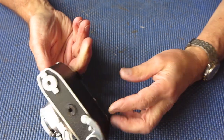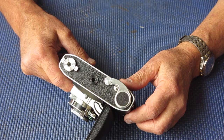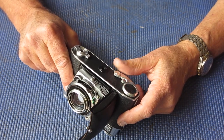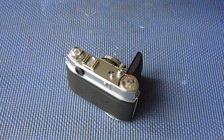So there's certainly something wrong with this. It's to do with the lock that should release the advance to wind on again at the end of the stroke, and it's not doing it. There are a few options of things that could go wrong: there's a spring that could be broken, the arm could be bent or damaged at the end, meaning it doesn't latch correctly onto the cam. I'll dig into it and we'll see what we can find.